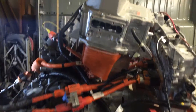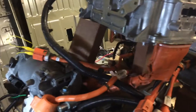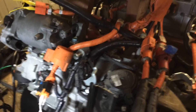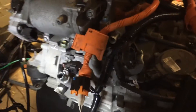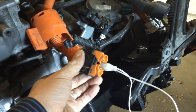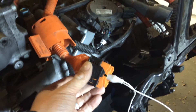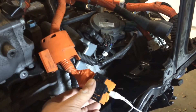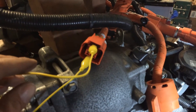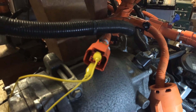Coming around again, we've got the inverter up on top and the motor still in place. A change from before: previously I had the heater connected, but now I've disconnected the high voltage line and just defeated the interlock. You wouldn't have to do that at this end of the cable — in theory you could do it at the other end back in the DC junction box — and I've handled that in the same way I did the AC compressor connector previously.